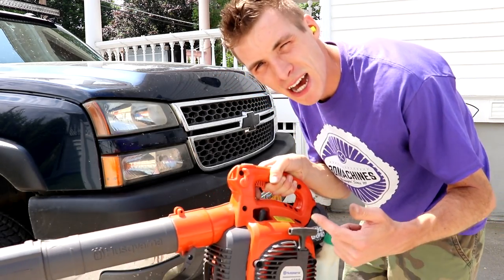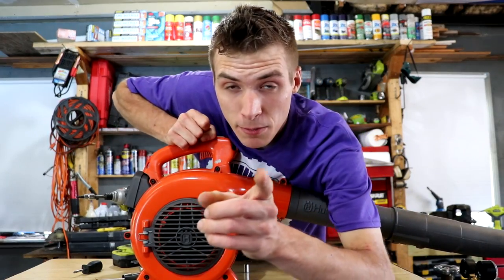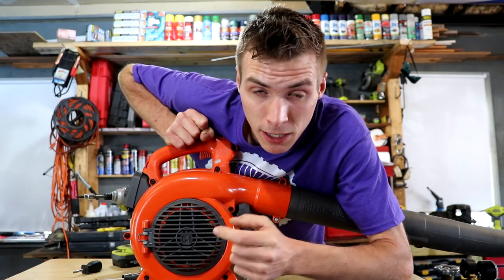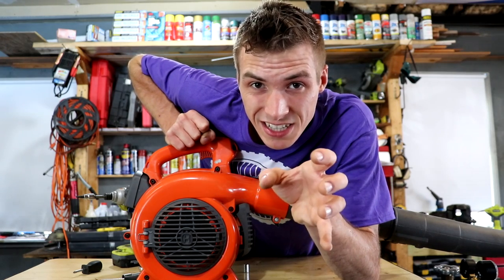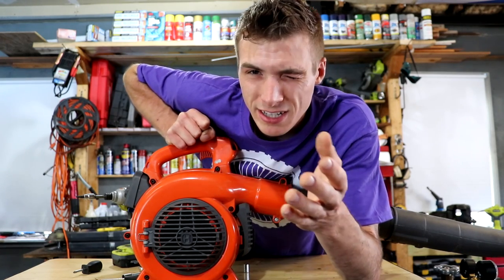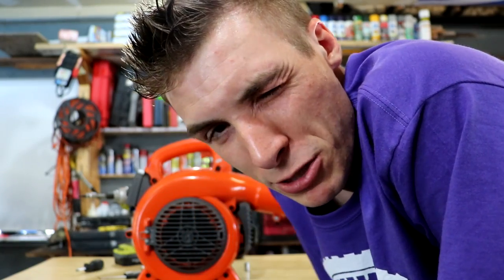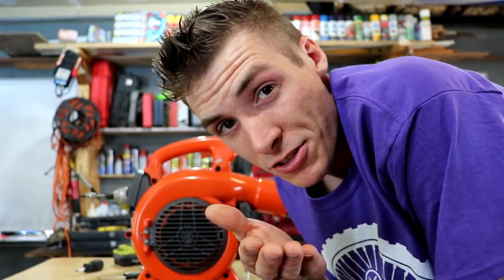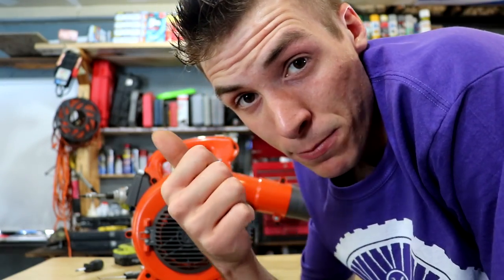This thing runs better than my KTM now. Update: the carburetor was still black after the ultrasonic cleaner ran for 20 minutes — the inside and outside were both black. I sprayed it down with carb cleaner, put it back together, and the engine is running very well. I think the Purple Power attacked the carburetor, so I'm not going to use Purple Power anymore. I did some research and found a forum where one guy who seemed really knowledgeable gave the specific product names he was using — that's what I bought. It was expensive but I want good results, especially for the GS. If anybody has an ultrasonic cleaner and has tips, leave them in the comments — I did order some supplies that are supposed to be good stuff.